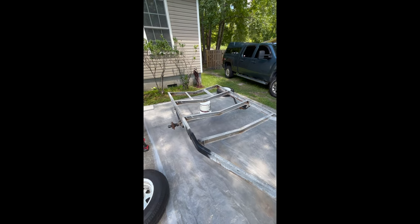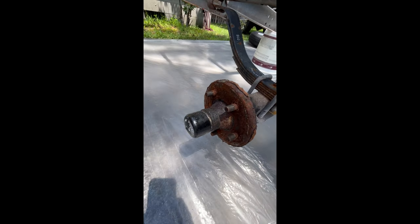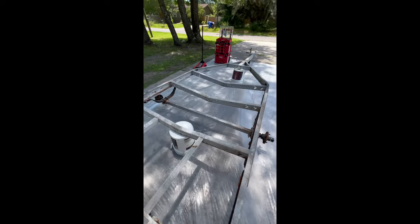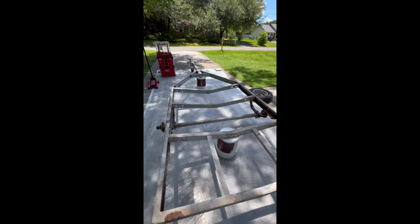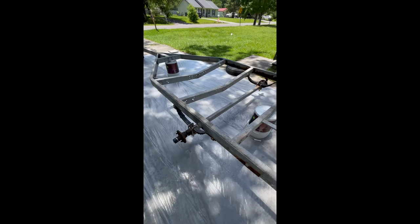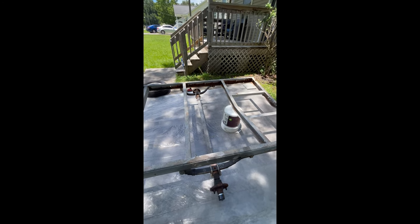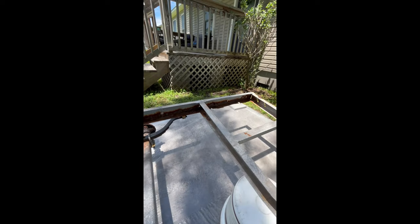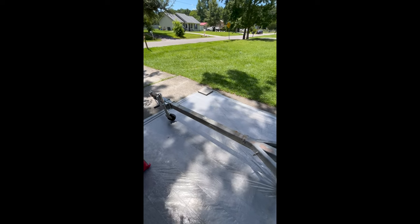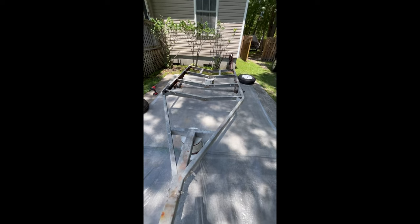Going to take it all the way down and turn it into a kayak hauler, but the hubs are pretty shot. Replaced the springs just to get by and get this trailer moved while the aluminum one got built. Took off all the bunks, all the hardware, and the brake lights — it's down to the bare frame. There's an L-reinforced iron that runs along it; I'm going to take that off and drop the axle so it'll just be a frame. Got to grind all that surface rust off; there are some bad spots I'll reinforce. I'm going to cut the tongue down now that there's no boat on it — pull the tongue off so it'll simply be the basic frame.